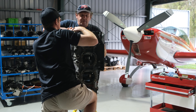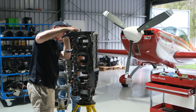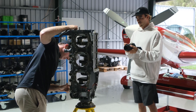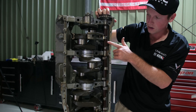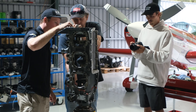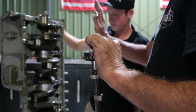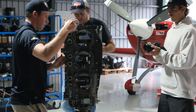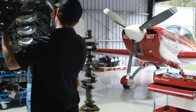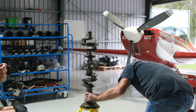Now just hold your camshaft. Is that corrosion on that or is that how they are? No, that's how they are. I'm going to lift the cam out now — that's quite good, real good. Roller cams are always good. When the case comes out, we're going to keep the lifters in the case — the case is going to be upside down. The seal's out, it's going to come off real easy. There's nothing else you can possibly pull off the engine — all in a day's work.